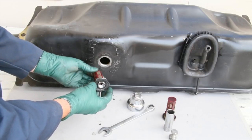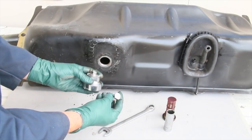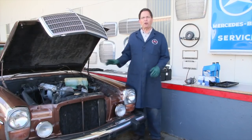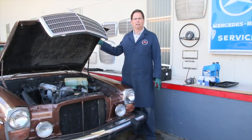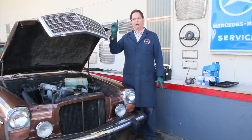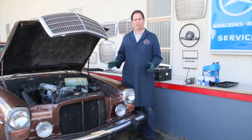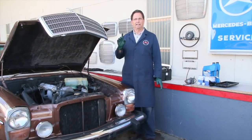We have special tools made at MercedesSource.com to provide solutions to common problems on these old Benzes. We were fortunate with this old Benz — no algae in there, no rust. When we dropped that fuel tank screen out, I reached my finger up in there and it was really clean, so I feel rather fortunate. We put the new screen in, replaced those rubber hoses on the back, and lowered it down. But the work has just begun — this isn't ready to drive down the road yet.